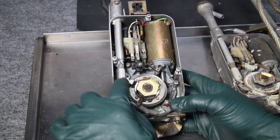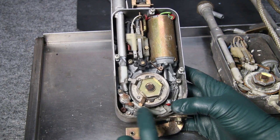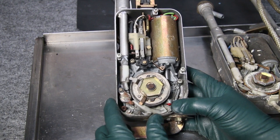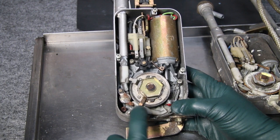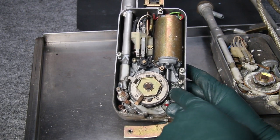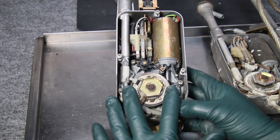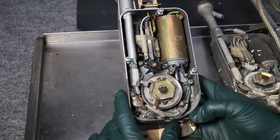Most of the problems I've found are right down in this area. Look at the corrosion, look at the rust. This wheel bearing, which rides on the antenna tail and rolls it into the antenna, seizes up. The spring rusts out and breaks. You get a lot of corrosion on the worm drive on the motor. Most total failures occur right in this area.